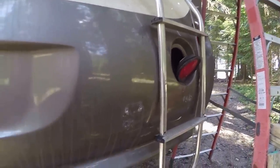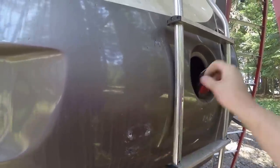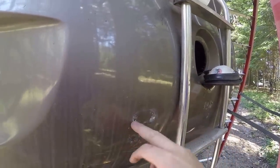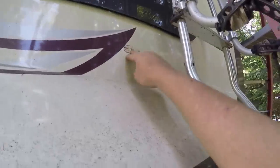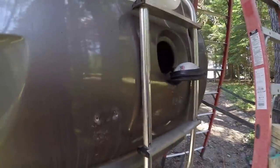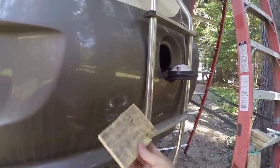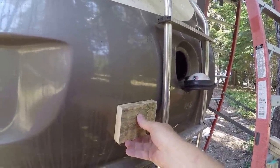What I found on this fifth wheel — Heartland Landmark San Antonio — is that this is just fiberglass. I took the tail light out and this is just the fiberglass coat with no backing for any of these screws. So what I'm going to do is take some treated lumber blocks and put them back behind here so when I screw in I've got some solid material to screw into.